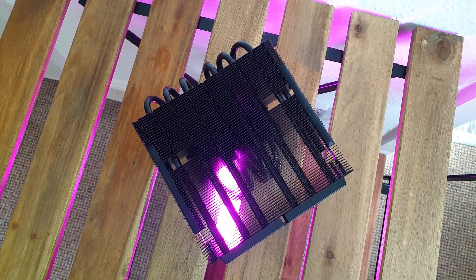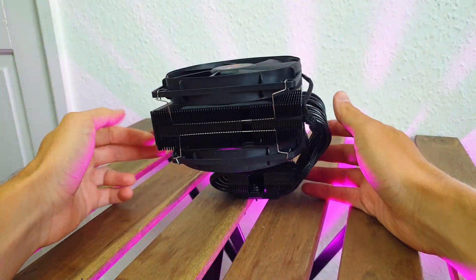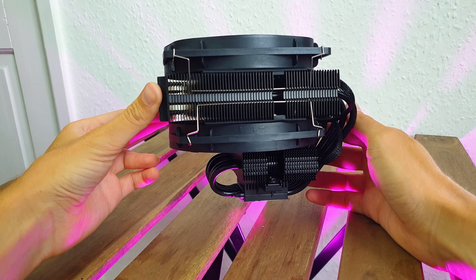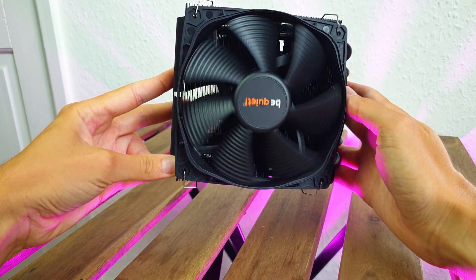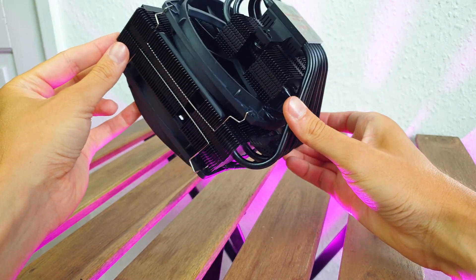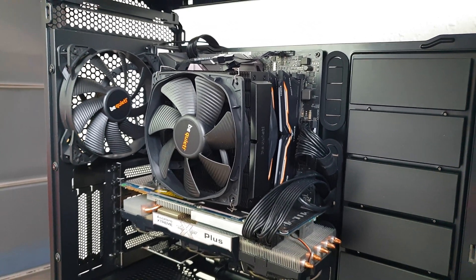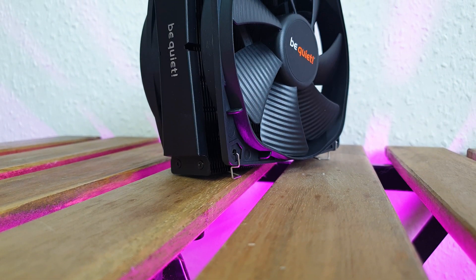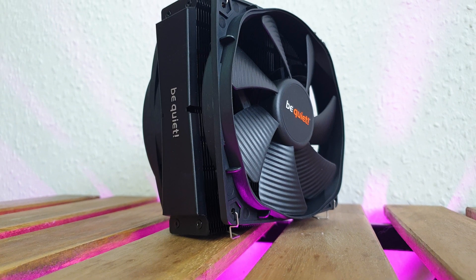Well, there you have it. The small tweaks and upgraded mounting system implemented in the Dark Rock TF2 have made it a potent air cooler. Its uniqueness in the form of a dual heatsink and dual fan setup from a top-down perspective could have brought disadvantages, but Be Quiet has managed to negate any clearance issues and offer plenty of RAM headroom with both fans attached. The fact that you can have a 230-watt TDP-capable air cooler under 134mm tall makes it a clear winner. Add the near-silent operation from the excellent Silent Wings 3 PWM 135mm fans, and the Dark Rock TF2 becomes the benchmark for all top-down air coolers. How many of you still have the original variant in the NCASE M1, or are you planning to upgrade to this one? Thank you for watching and see you in the next one.